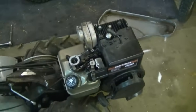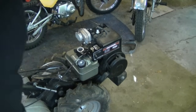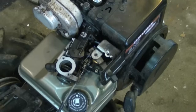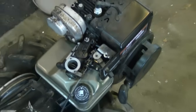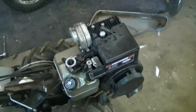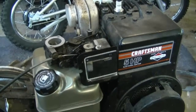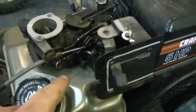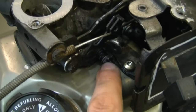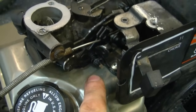Now I'll give it a quick start just to show you guys that it runs good with this configuration. So this is the linkage configuration for your Briggs and Stratton 5 horsepower engine. If you get a lot of surging up and down after everything is clean and good, you may want to unscrew the adjusting screw to about a turn and a half to two turns out — that should stop it from surging.